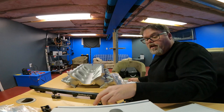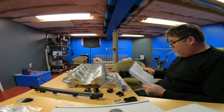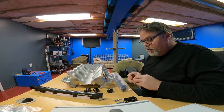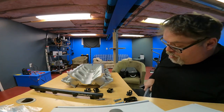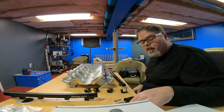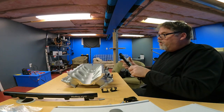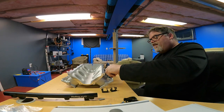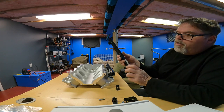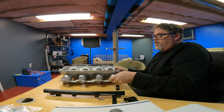We get small, big, small, small, large - so four large and four small clamps. What that tells me is it depends on the injector you're installing, since some are bigger injectors than others. Let's just put the small ones on hand tight just to see what it looks like. The fuel rails actually go this way. I wonder why the Holley logo faces in on the intake - why wouldn't it face out? I guess it does look kind of cool facing in too.